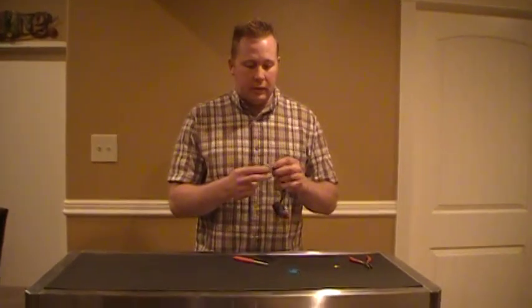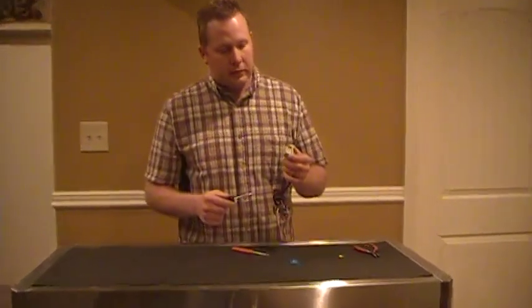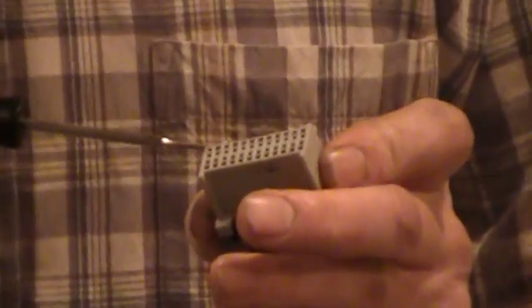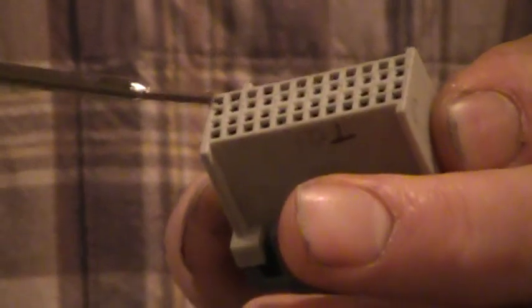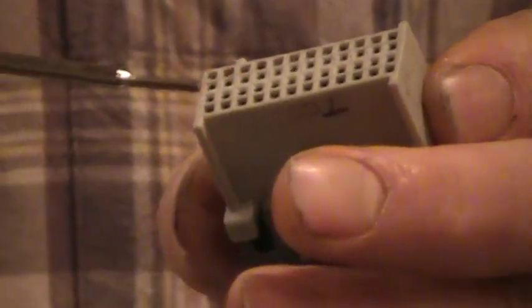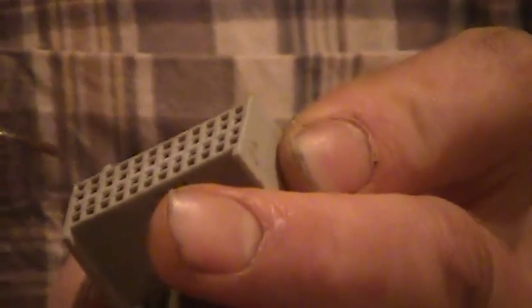This particular connector is off a 2003. After you've got that blue terminal securing piece out, there's a large square hole and a small square hole. Don't stick anything in the small square hole — that's the sensitive terminal part that plugs into your cluster. The larger hole is where you'll see a little metal tab, which is the lock release. I'm going to stick my terminal release tool in there, wiggle it around, and release the little locking finger.